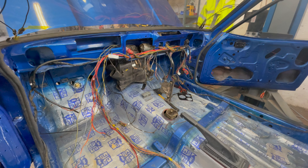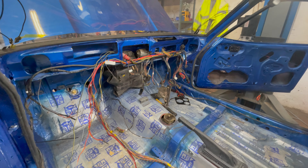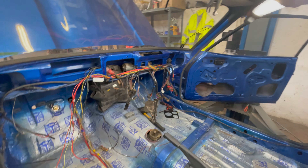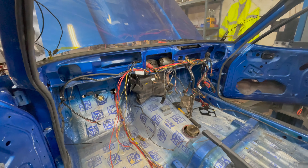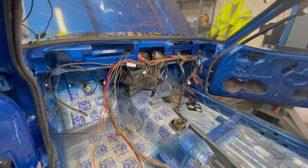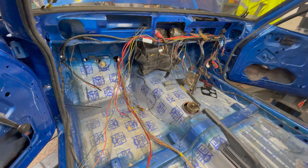The wiring — I was never giving up the other night whenever I was sitting in minus two, freezing, trying to work out the wiring. But I think this is the best possible solution without wrecking myself or my head. I was intending to rewire all that from scratch, and now I see that I am a mentalist — too far even for me. The likes of this starter signal wire will go out through the split grommet and down onto the starter. You just try and get all the conduit sorted, all the wires shortened, routed neatly, cable tied up, and then loom-taped. Once I have the fuse box in then I can decide the location for the ECU — I'm going to take the glove box home and try to squeeze it all in.